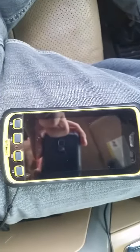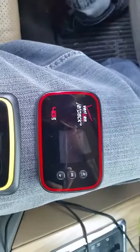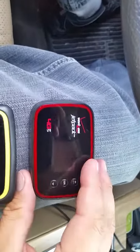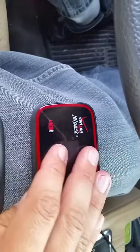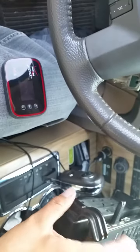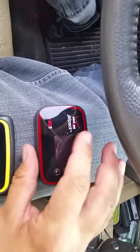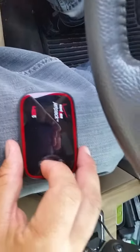If you're trying to connect your Juno T41 to your Verizon Jetpack and you're having difficulties doing so, this may be one of the reasons. If you typically plug your Jetpack into the USB port of your computer for charging purposes, sometimes this will default and throw it into a tether mode.